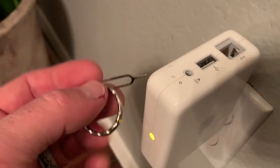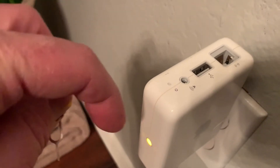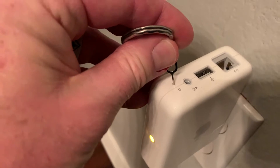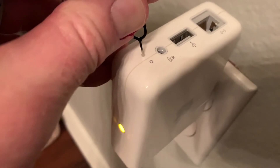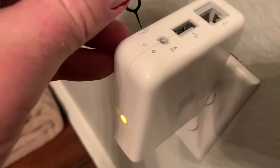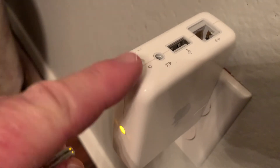The button is a touch small so I like to use the SIM card key for my phone — if you need something like this I'll put a link in the description box below. We're just going to come over here, push down on that button, and hold for roughly 10 seconds. Looks like eight seconds was all we needed. You see the blinking amber light — that means we can release, and once you see that steady light again, this has now been factory reset.